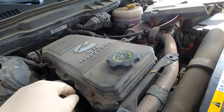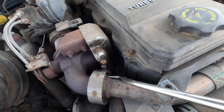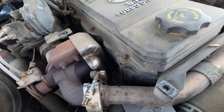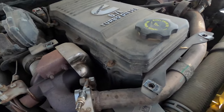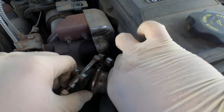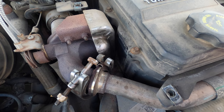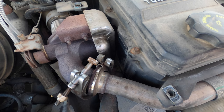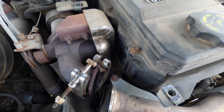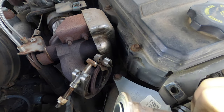If I don't find coolant, I guess we're still going to pull the cooler and see. I got the old trusty pick - see if I don't break it today. Got those off. Let me loosen it up a little bit more to make it easier. Pop it off. I don't see anything - there's no redness in there. You may not see it back at the end, but yeah, there's nothing in this area. It's kind of dry, and same thing in the EGR valve.